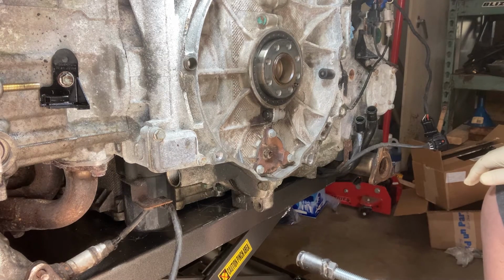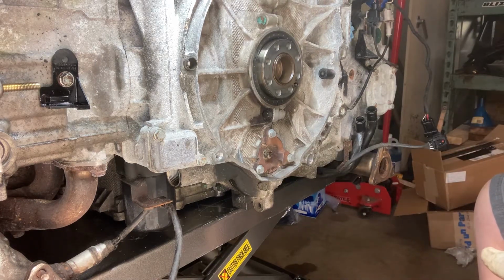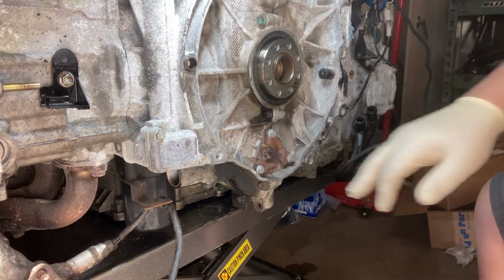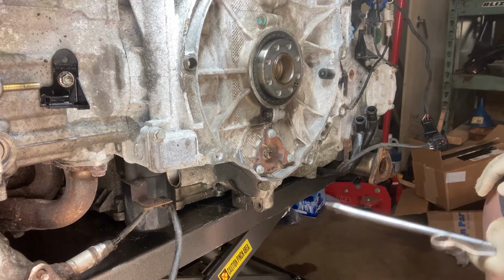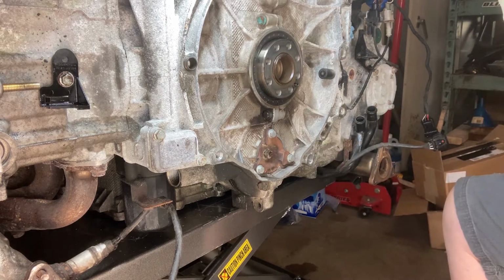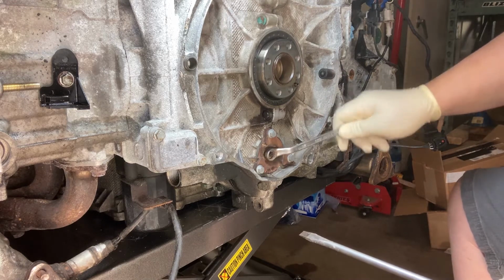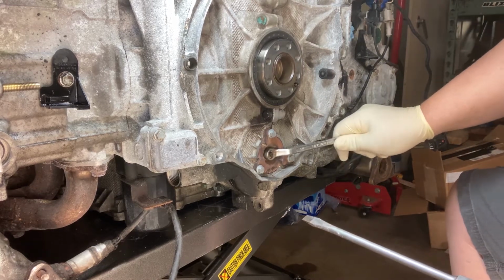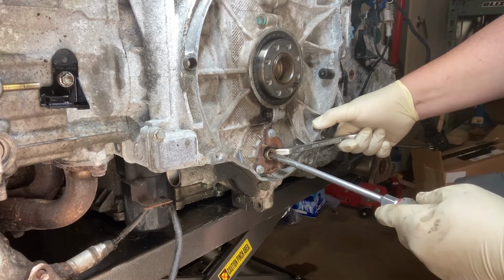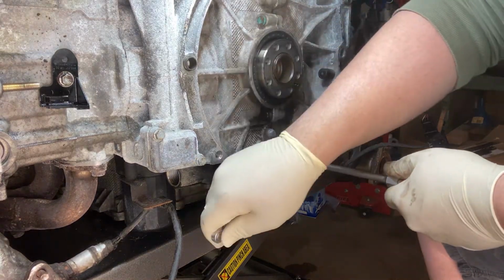So we'll start out by getting this middle nut loose, and then pull the plate off after taking these 3 bolts off, thus exposing the bearing in all its glory. For this, I do not have a set of metric box wrenches here at home, offset boxes, so we're going to hope that a 1/2 inch will do. We will hold this in place. Seemed to work out just fine.